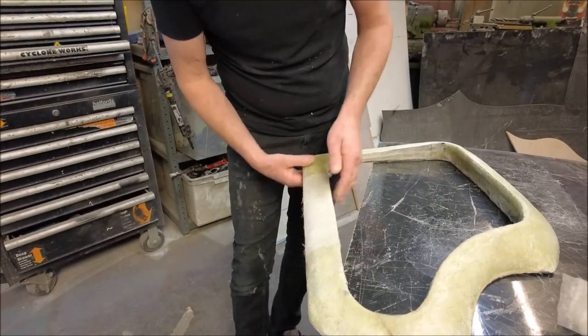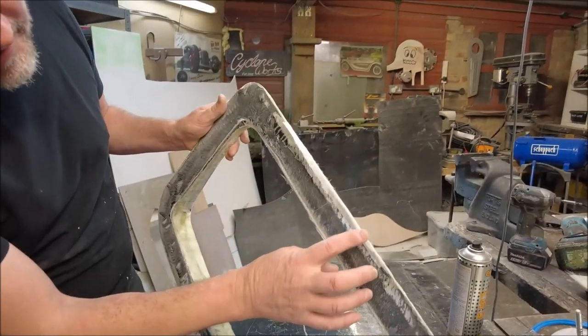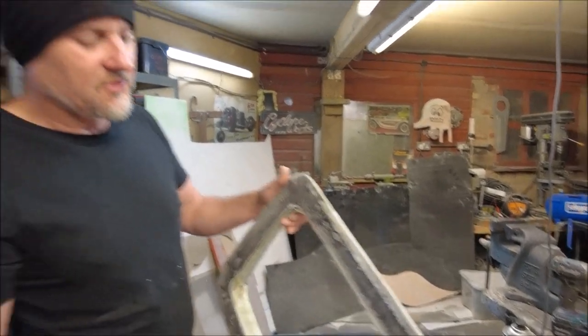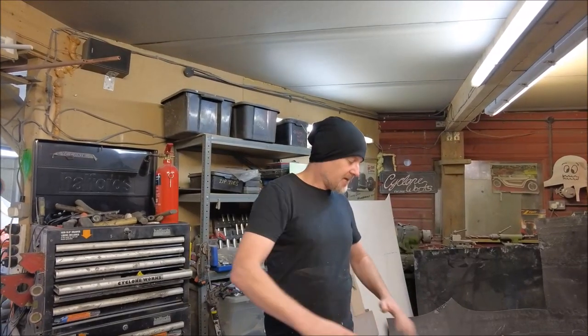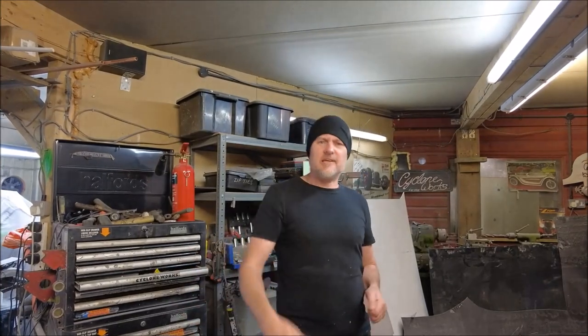But see there, that's gone over there. I'll have to put a bit more on there to wrap around, but as long as I've got a coat of this round there, because I will only lightly sand this and then go over with the filler, so that I don't sand through this. If I sand through it, I'll skim it with filler first and get that filler smooth over it. Obviously I'll nib the little lumps and bumps off it, but essentially that's it.